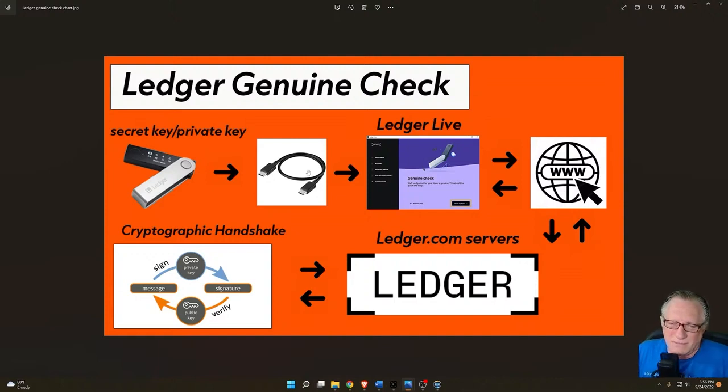As soon as I see that message, I say it's just a glitch, try again, and then it works. We've got the cable and we've got the software — this is all local to you. So if you get the message that your device is not genuine, first thing you do is try again. Reboot your computer, reconnect the device, and try again. If that doesn't work, try the cable in a different USB port. If that still doesn't work, try a different USB cable — it's a standard USB-C cable. It could also be a software problem on your computer: an old version of Windows, an old computer, a fragmented hard disk. All kinds of environmental issues can cause you to fail the genuine check, but usually if you try again it'll work. Computers glitch.